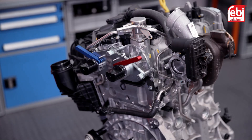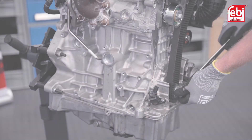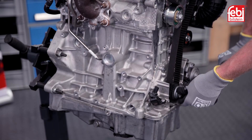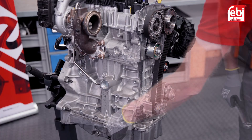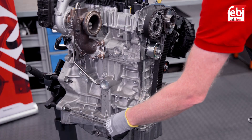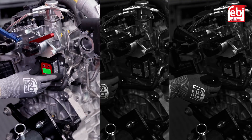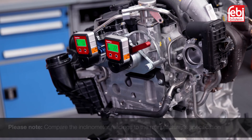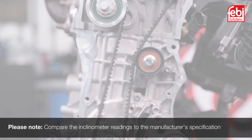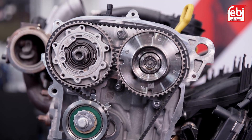To check the timing, first release the red and blue locking levers by removing the lever stops, then take out the crankshaft locking pin. Turn the crankshaft two complete turns, stopping just before returning to the TDC position. Next, reinsert the crankshaft locking pin and turn until the crankshaft stops against it. Recheck the camshaft angles using the inclinometers and compare the readings to the manufacturer's specification. If no adjustment is required, the camshaft pulleys can be tightened to the manufacturer's torque setting.